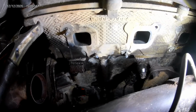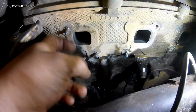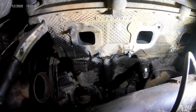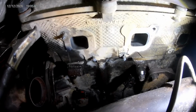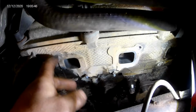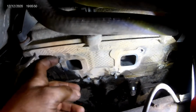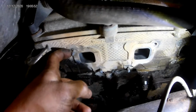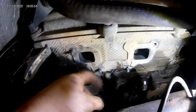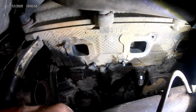But normally also, I think a little bit of the heat from welding gets in there and also helps break them loose a little bit. But like I said, that's kind of my little tricks to getting them out. Like I said, you can weld a nut to them, use a little stud remover, or if they're flush, you can build them up with weld and then grab them with the vice grips or something along those lines.